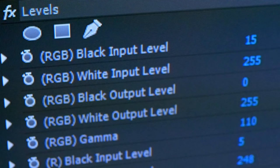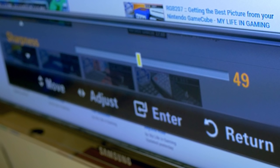If you want to use a TV as a computer monitor, make sure you turn sharpness to the neutral setting so that every pixel is what it should be. Zero in my case. Artificial sharpness will really strain your eyes.